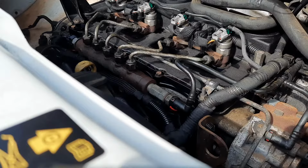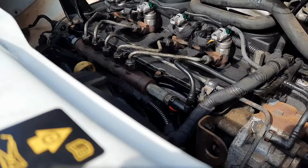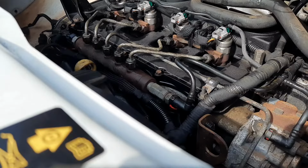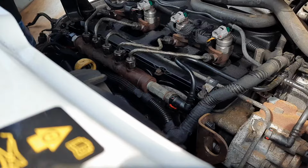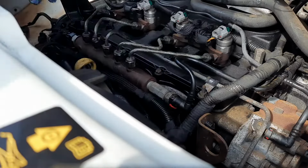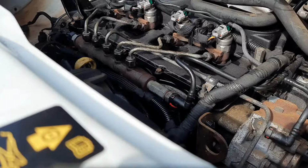Right, as you can see, it doesn't want to fire, which the reason is the camshaft plug wasn't pushed in far enough, as you'll hear the click in a minute when I realise. I hope you've heard the little click there of the plug connecting. Okay, well thanks for watching. Let's see if it starts now.